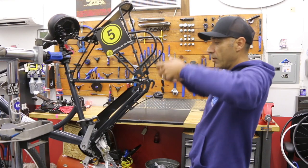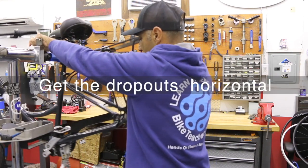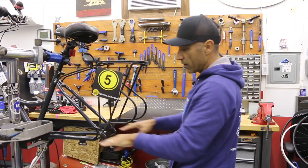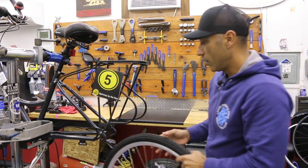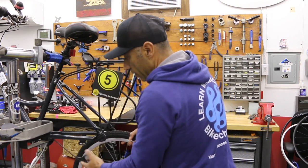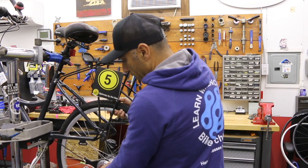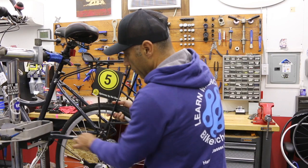So let's put this in the right direction — I don't want to be working up here, I don't have good leverage. We're going to tilt the bike, get this in the down position. So now we have the dropouts here. These are horizontal dropouts because they run lengthwise almost parallel to the ground. We got our gear on the right side coming up here. First thing I'm going to do is go ahead and attach your brake, and as long as we keep this line straight and there is some notching, get that on there. Our line should be fairly straight in line with this tubing right here — that's our chainstay.